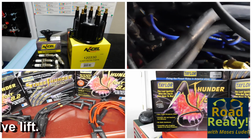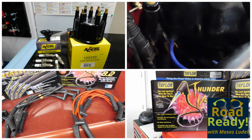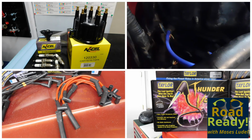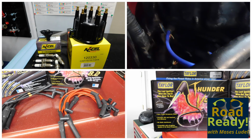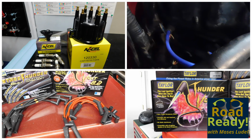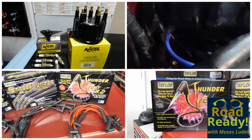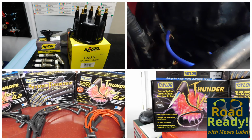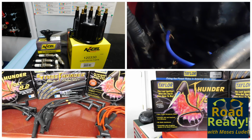A gasoline spark engine depends on igniting a compressed air-fuel mixture. Historically, spark was delivered with a distributor ignition. Fundamental components included a distributor cap, rotor, and spark plugs. These components carry forward from the breaker point ignition era into the electronic higher energy ignitions. The 1999 XJ Cherokee 4-liter engine in this project is the last 4-liter engine to have an ignition distributor.